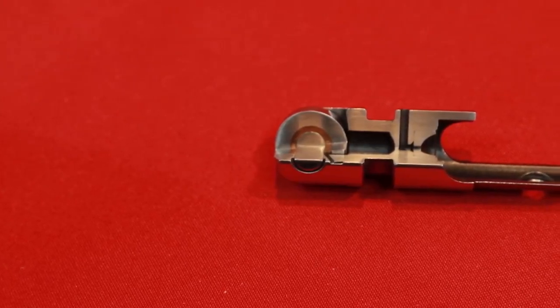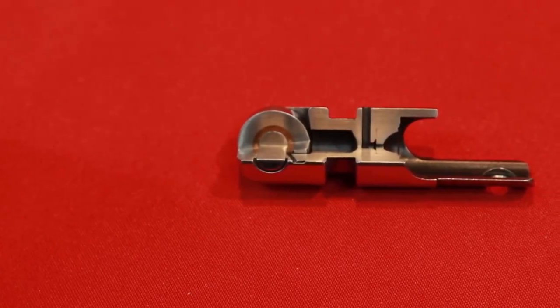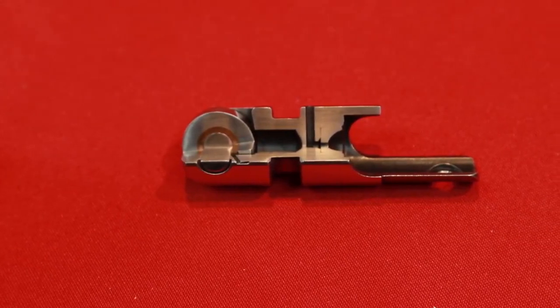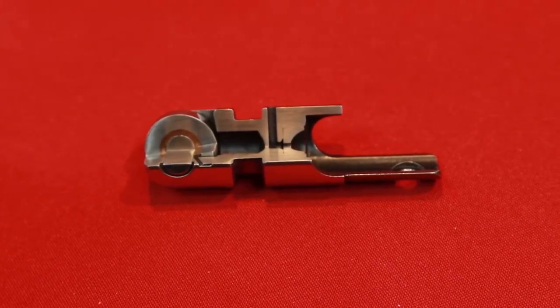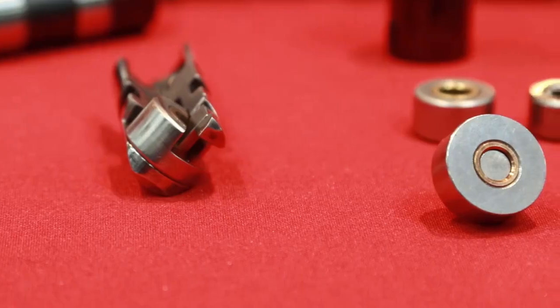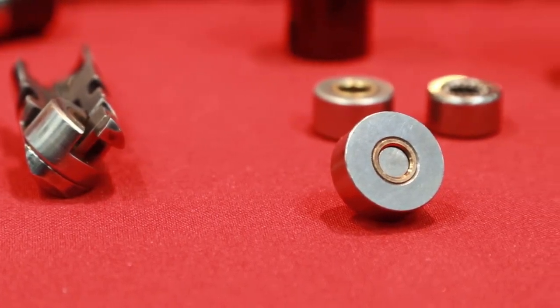Anytime you're rolling on the needles, the contact patch between the wheel and the needles is only about 3 of the needles. So all that load, all that dynamic pressure going up the lobe, is only on 3 needles. With the bushing, it runs on hydraulic pressure. We all know how strong hydraulic pressure can be. It runs on a bed of oil, and it takes that footprint that's 3 needles and puts it all the way around the lifter to share the load. So it's about 350 to 400% extra load capacity.